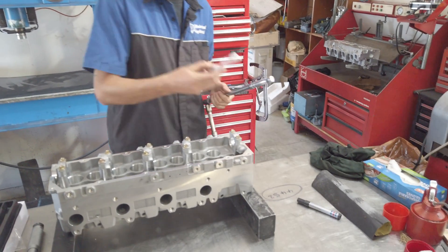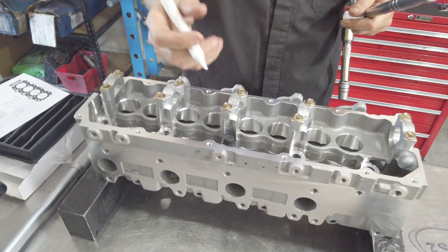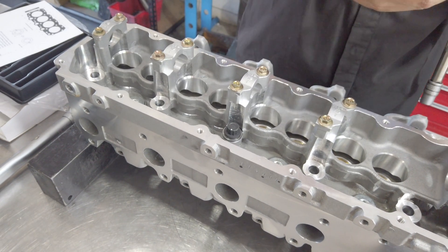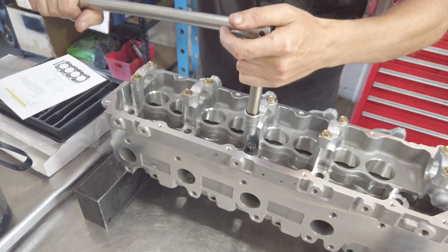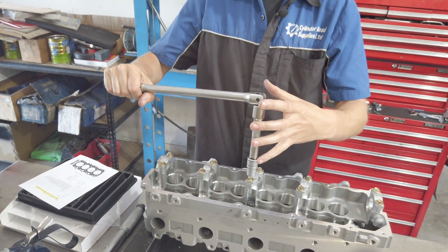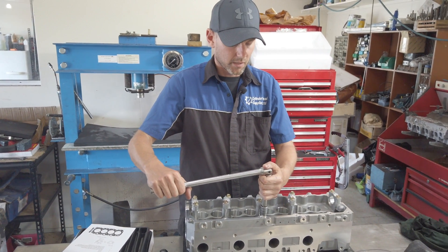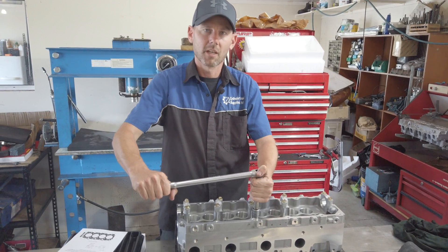What I always do is get a little Twink pen or paint and mark each bolt with a tiny dot, all in the same spot at say 12 o'clock. That gives you a visual reference so you can just eye it. A lot of shops do have flash angle gauges that go on the power bar, but you don't really need them — a lot of shops I've worked in, they just end up in the cupboard and never get used.